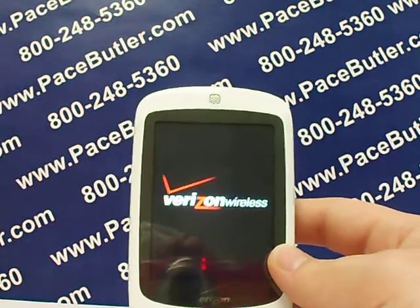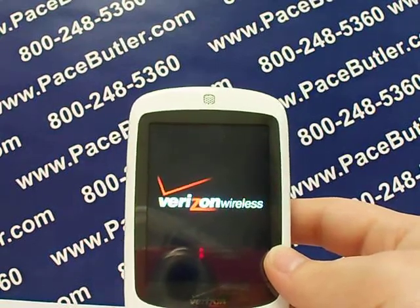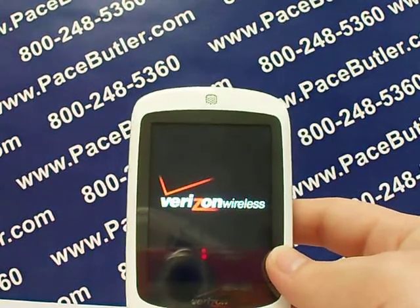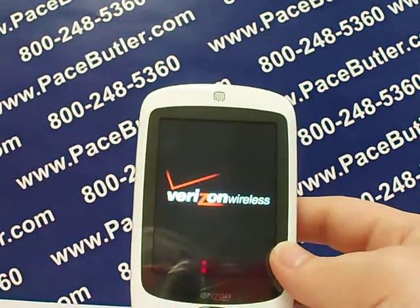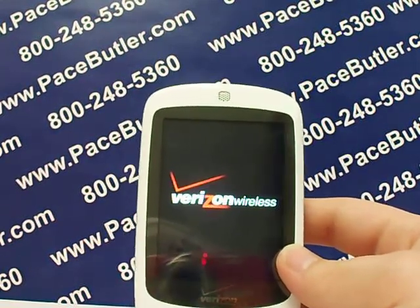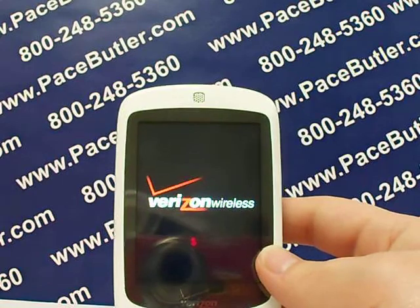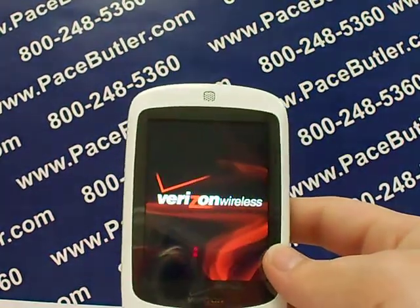Your best bet is to do the steps we did and then take your SIM card out to ensure that all your contacts are off the device. If you have a carrier that doesn't have SIM card capability, you can go through your contacts and messages just to ensure that all that information is off the phone even after you do a master reset. It'll take just a few moments to power back on, but when it does, the data on your phone should be cleared.